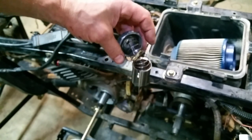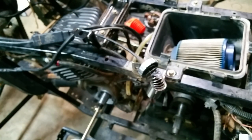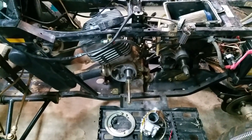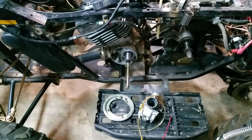This sometimes gets tricky. Then you'll slide this back into the top of the carburetor into the throat end of it, and just make sure everything operates properly as far as the throttle mechanism. If it's not smooth on the throttle, that means something is installed wrong, it's dirty, or something's just not right. Anyway, that's the Mikuni VM30SS — it's also similar on all kinds of other VM series Mikuni carburetors. Check out our other videos; we've got all kinds of carburetor, motorcycle, dirt bike, and ATV related stuff. This happens to be a 2006 Polaris Trailblazer 250 two-stroke, and it applies to all kinds of different Polaris two-stroke models. Y'all have a good day — like, subscribe, follow, and click the bell!